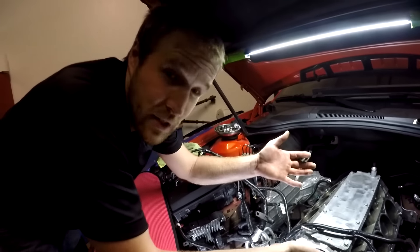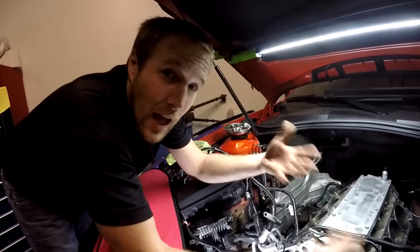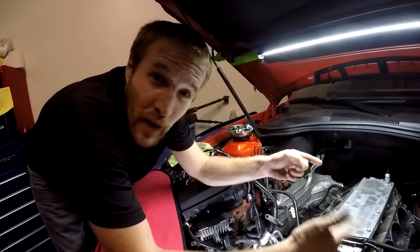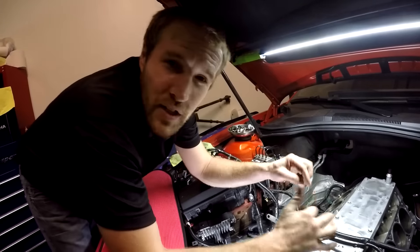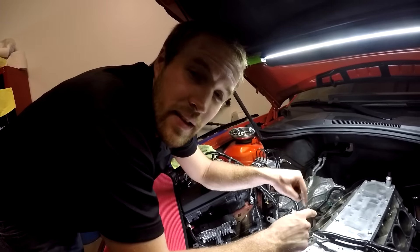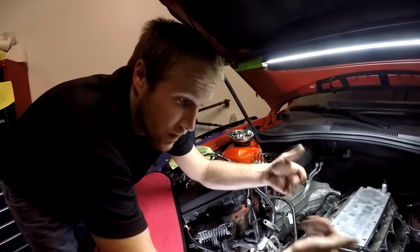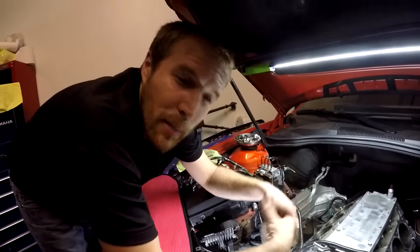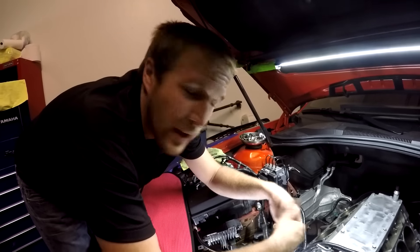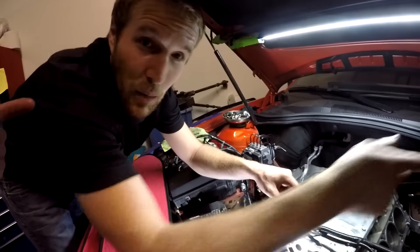You can in fact do this without pulling the heads, but I don't like doing it that way. On top of that, we were tackling a lot more than just the cam — we were going to do all the valves, valve seals, with new valve springs. We ended up just doing the updated springs and seals, which are a little bit more difficult to get to in the back. So we did decide to pull the heads. We're also doing exhaust manifolds, which gives us a little more room to work with — that little magnet and bolt thing.